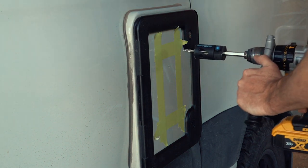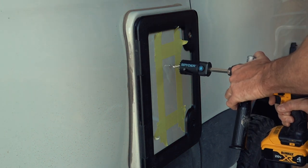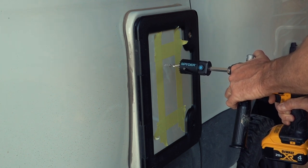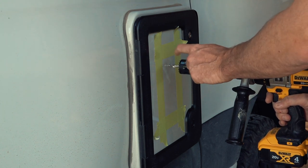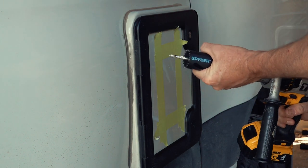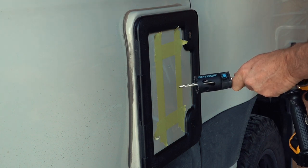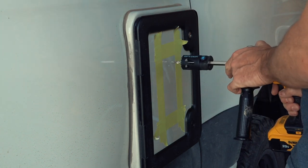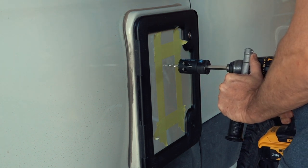The Soak system is a German invention, so all measurements are metric. They call for a hole between 36 and 37 millimeters, but I only have an inch-and-a-half, or 38-millimeter, hole cutter. It will work fine — I'll just need to caulk around it a little bit.